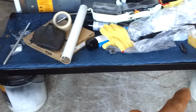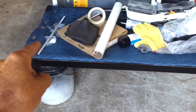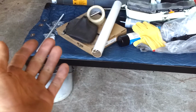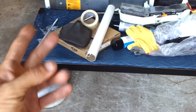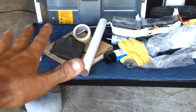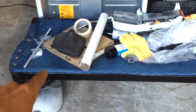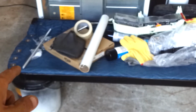But on the seat frame itself, the cushion was good, but on the ends where the cushion sits on the frame, since it's framing and then it goes to the wires, it ripped the cushion apart. So I used a spray adhesive and I glued the cushion back together, and to hopefully get the cushion to just sit on top of the spring or the seat frame and not sink down into it, I went to Harbor Freight and I got one of their $8 moving blankets, and I put it on and I rolled it over one time, trimmed it to fit the frame, and then it has screws and washers holding it to the frame all the way around to the other side.